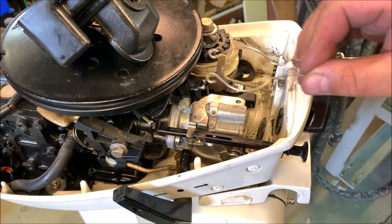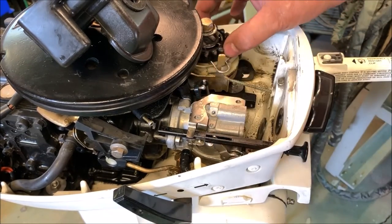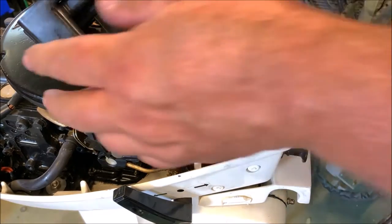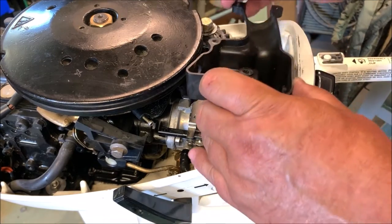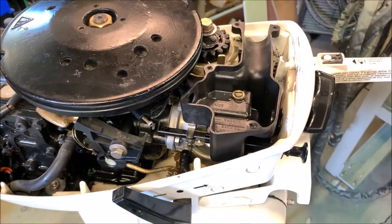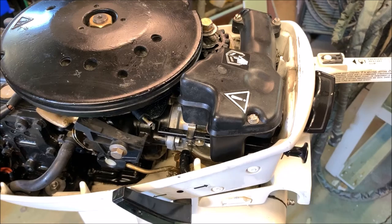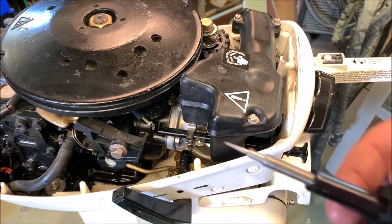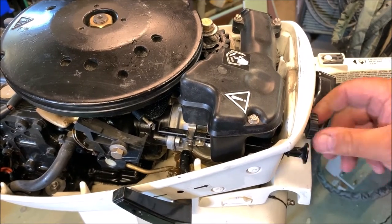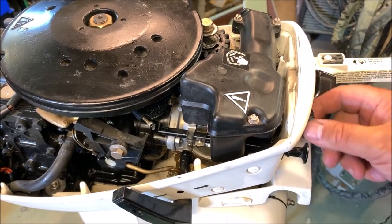Before you put the air breather box back on, now snap this little thing. There's a groove right underneath this gear that this thing slips right into. This keeps it trapped. Once that's in place, then your box can go on. Now we can put this back in, as it feeds through the air box, lines up in there. It's going to give it a little push and turn. It'll bite into that rubber and go right on in, so the rubber keeps it from moving freely.